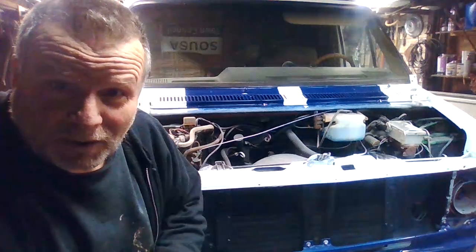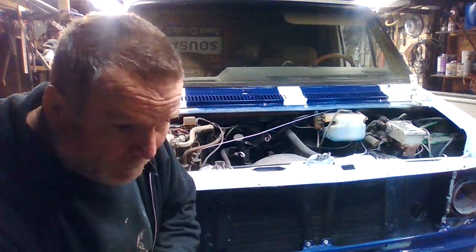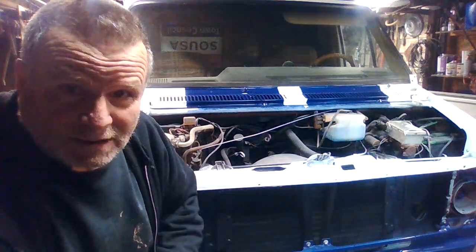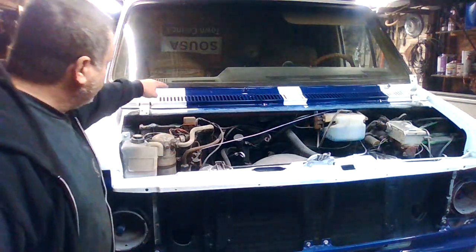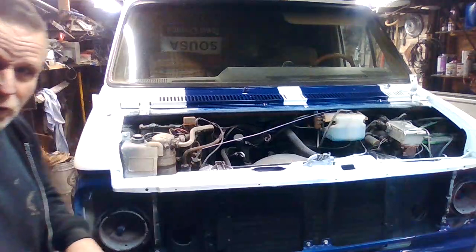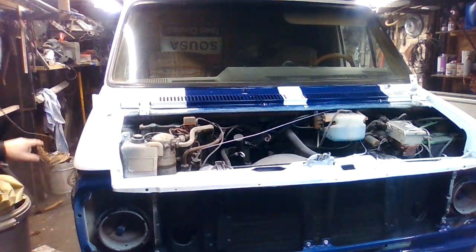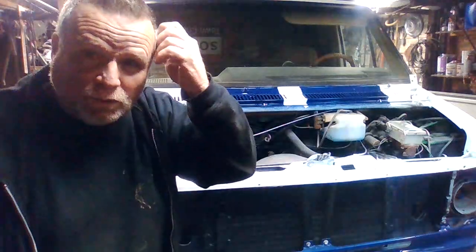Mostly because I really thinned the paint down. It's getting chillier and I wanted to spray at low pressure, so I really thinned the paint down. But that's all going to get covered with the red pinstripe, which is going to come right across the hood and is also going to follow this blue line around the body, around the cab. So the red pinstripe will take care of that. I'm not real worried about it. Most of it will come out when I wet sand, and then the pinstriping will finish the process.